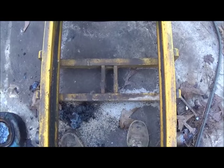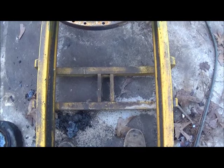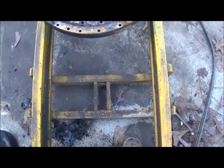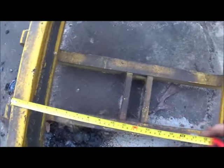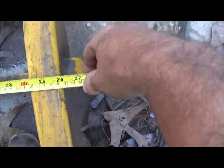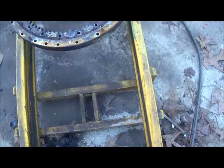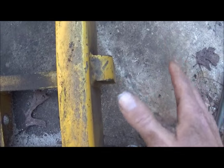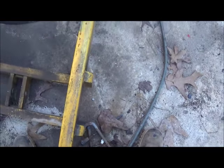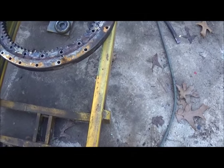Frame width on the truck is 34 inches, and we're going to have two 2-inch rails running up, so that's 30 inches on the ID of the subframe. From the outside of this one, it's about 27 and a half inches, so that gives us 2 and a half inches to make up — that's 1 and a quarter inch each side. So our subframe is going to run an inch and a quarter out from here. What I want to do is tie that subframe into this, and this is stronger than that subframe with the thickness. We're going to tie it in front, back, center, and wherever — it'll all be one solid piece when we're done.